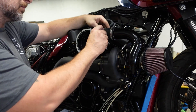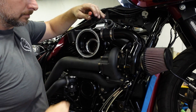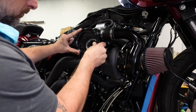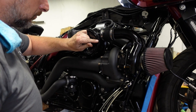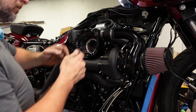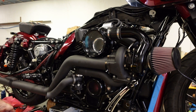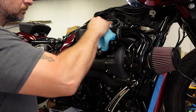Tighten up the hose clamps for the charge input. Then we'll carefully install the clear part of the cover, being careful not to leave any fingerprints on the inside — the outside is fine because you can wipe them off, but the inside is the last chance you're going to have for a clear window into the plenum. I use blue Loctite on the retaining bolts. Get them all started, and I will — just kidding about precision torque — just apply some slight torque. I'm sure there's a torque spec, but after you do this enough times it's pretty simple to guestimate the right amount.